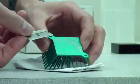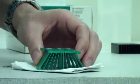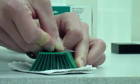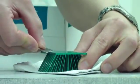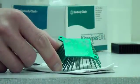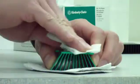You're undoubtedly going to be left with a bunch of residue on the surface. One of the things that I like to do is put a small amount of alcohol on the surface and kind of use this as a lubricant. That way we can go back with the razor blade and get a close shave on there to remove some of that leftover TIM. When you have the surface pretty clean, then you can get a lint-free cloth or a wipe with some more alcohol, and with a bit of rubbing, you should be able to remove the rest of the phase change material.